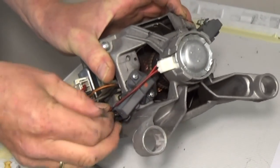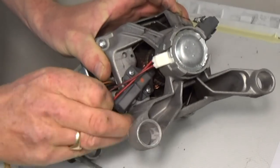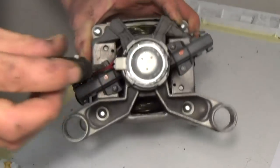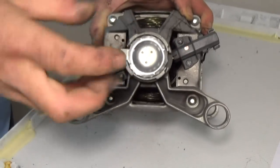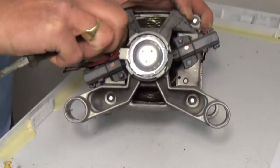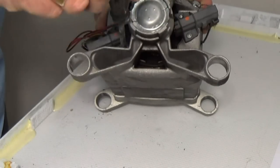So the brush has come off quite easily. The one on the left hand side, you can see here, has the tacho wire clipped to the brush, so just unclip that. Then you've got two screws which need to be taken off. And the brush itself sits on two lugs which locate into the motor chassis, which you'll see in the pictures in a minute.